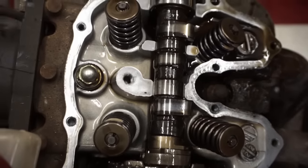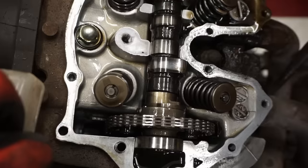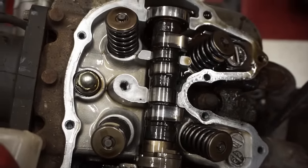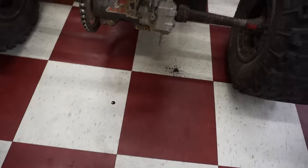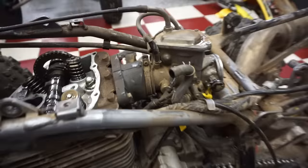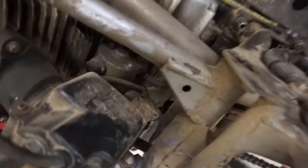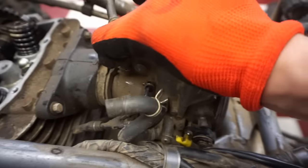Here's the gasket that failed - you can see right here, I think it was leaking out of there where the paint's worn off. That's usually where it fails. Look how much oil was in there - it's a good sign. Yeah, it looks like a stock cam. Stock cam typically means they probably did not big bore it - usually people put like a Stage 2 or Stage 3 Hot Cams in if they're going to big bore it. Guessing it's not big bored. Also I'm seeing straight oil coming out of the pipe, which is probably not a great sign. Tearing out the carburetor - looks like we do in fact have the original Keihin carb, so that's good. I don't like those cheap aftermarket ones.